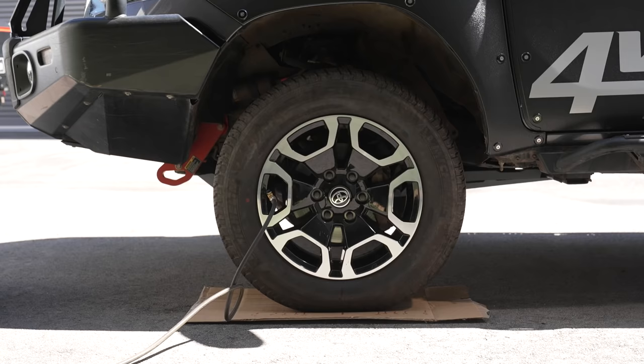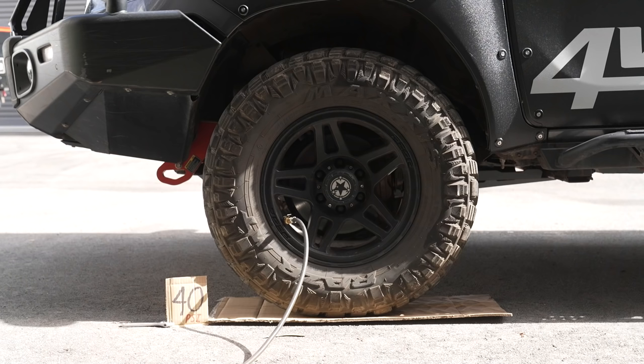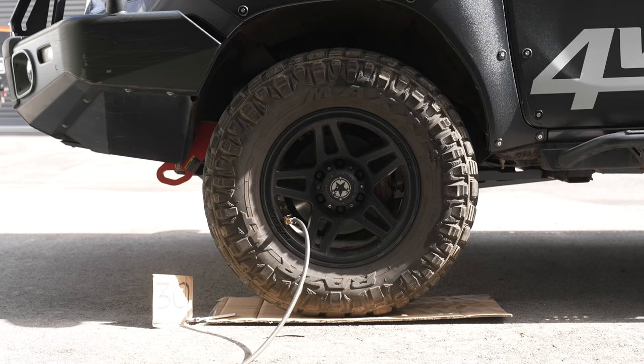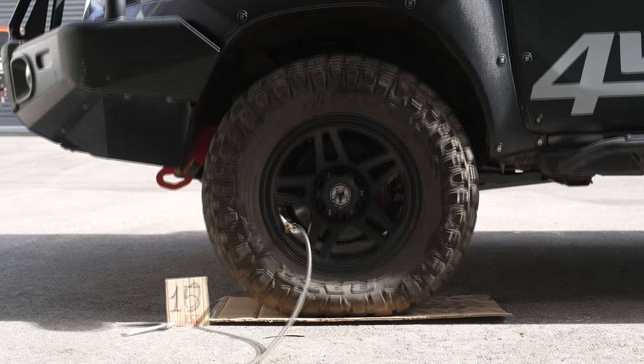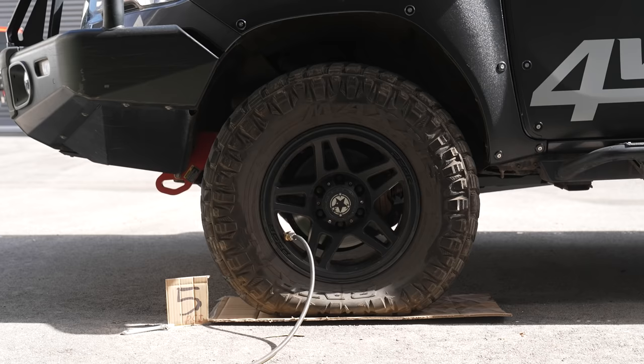This is how much you can increase your footprint by lowering your tyres — we're going to go from 5 psi to 40 psi, on two different wheel and tyre combos: the stock and the mud terrain. First the 33-inch — actually 32.7 at 40 psi, sitting there nice and proud. At 30 psi you don't notice too much drop. At 20 psi you're starting to notice it a lot more. Then at 15, and when you get down to 10 it really starts moving — that's where it bags out and gives you that lengthwise footprint. At 5 psi, probably the lowest you'd take this tyre to, the sidewall is still holding up and fairly strong.